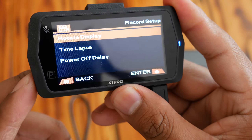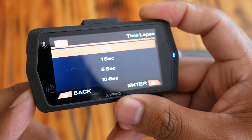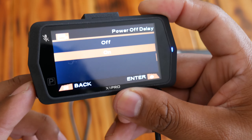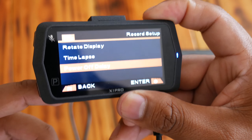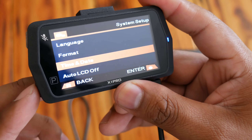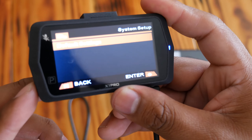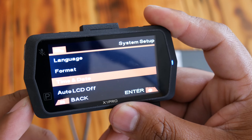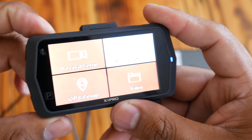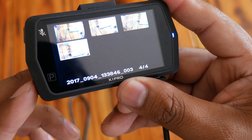The dash cam also has a parking monitor mode. The camera needs power continuously, so a power bank or hardwired connection to your battery is handy. The G-sensor triggers recording when it detects an impact — you can set sensitivity to high, medium, or low. The camera's built-in 130mAh battery only lasts about 30 minutes, which is why most dash cams require being plugged in. Manufacturers keep batteries small to avoid overheating risks. Parking mode activates automatically after five minutes of being parked.